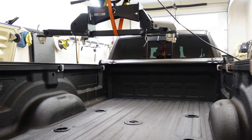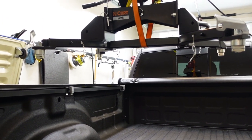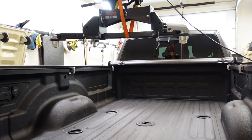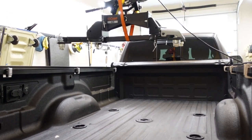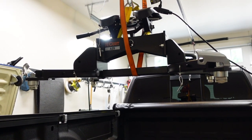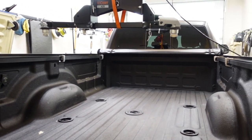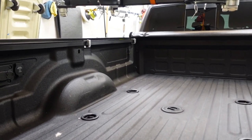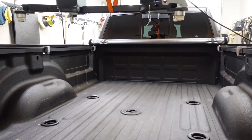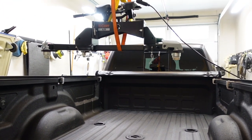A couple more safety considerations: just like any live load, you don't want to be standing aimlessly under it for no reason — and that includes kids playing underneath it. If you pull your truck out of the garage, make sure kids or other people aren't walking or standing under this live load. Even when lowering it into the truck bed, be very conscious of where your feet are so they're not anywhere near where the base could come down. Also watch your fingers so they don't get pinched as it comes down. Use common sense and follow all the safety guidelines in the Warn manual.